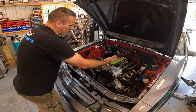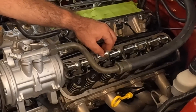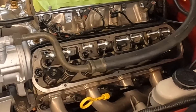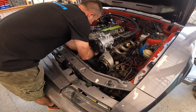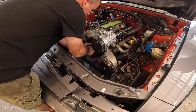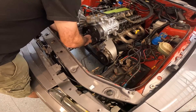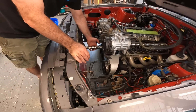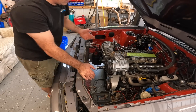Moment of truth. This is what it looks like with these things — it's pretty sweet. Everything's attached and should be pulled up enough. I literally reached down to grab the cam and it already started coming out, so I know this is going to work. Look at that — is that not freaking amazing? That's about how far you can go, almost able to get the camshaft out, but that's why you need to go ahead and pull your condenser out rather than taking the risk.